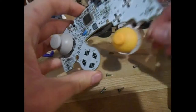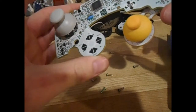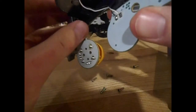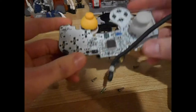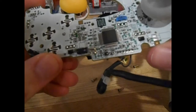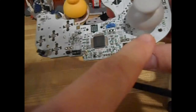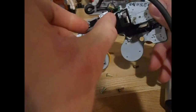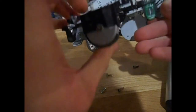So now we have the motherboard of the GameCube controller. It's not really that complex if you know what you're looking for. To get easier access, we are going to find these two black tabs right there, push those in gently, and this thing just kind of folds away, like so.